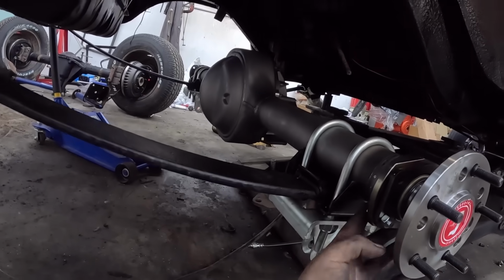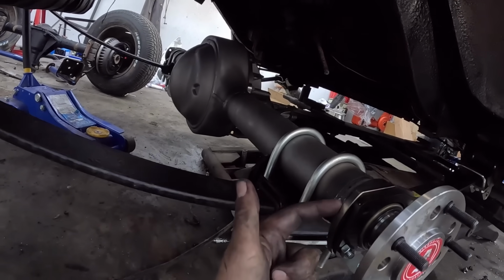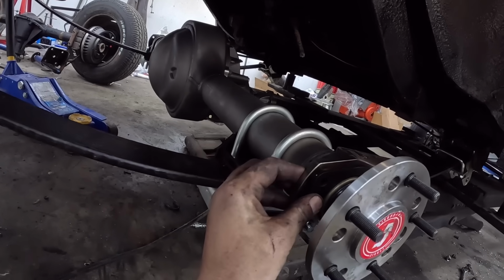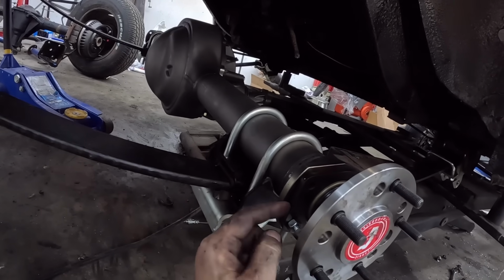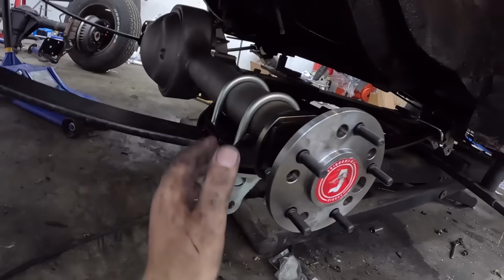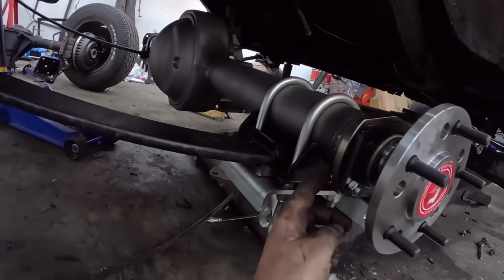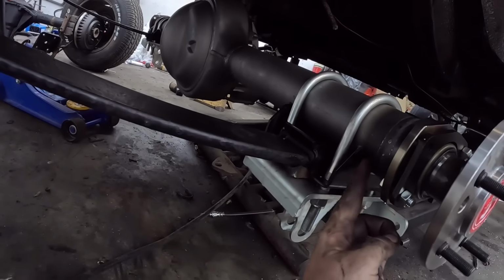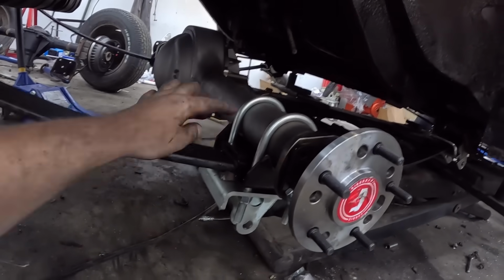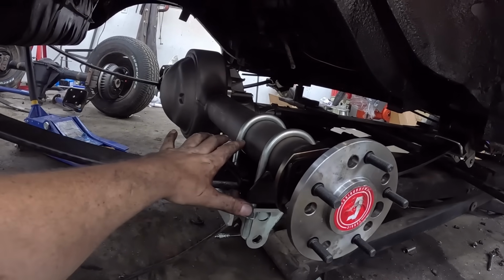Well, I didn't want to have the axles and all that in because I didn't want the backing plate. So it actually goes axle flange, backing plate, then this, and it all sandwiches together, right? So we have a bit of a gap there. But if we have the backing plate on, it'll be down to here, like a big circle, obviously, like a 10 or 11 inch drum. Well, right now it's very easy to get in and weld. And I want to obviously weld both sides of the pad to the tube. And I can also weld a thing front and back if I want for real rigidity.